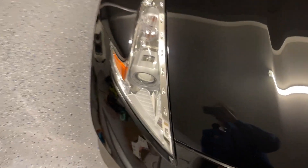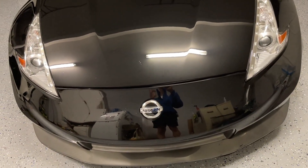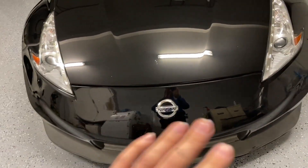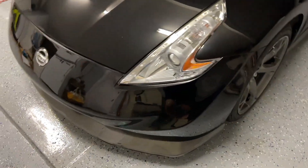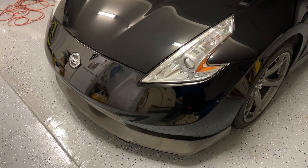I ended up buffing out the glass and everything, so I have a really nice reflection. I actually did a pretty good job getting out a lot of these swirls. I could have gone a step farther and wet-sanded, but I just really wasn't interested in that. The headlights look grayed out even though they weren't foggy — it still looks so much more crisp when you hit it with the polish. I did the headlights and taillights with the one-inch polisher, which took a while so I split it into about three portions. I did end up buffing out the front bumper even though it was damaged, and I'm surprised the paint actually came back pretty decently on it.